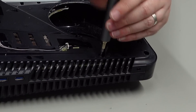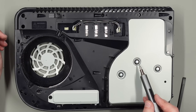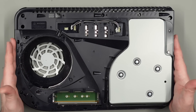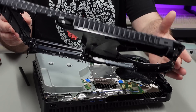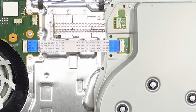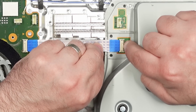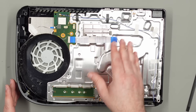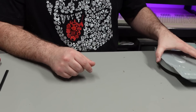So let's start with this screw — find it and remove it. The only ones you want to leave in place right now are these four screws on the optical drive. Once you've removed all the screws including the SSD cover, this black piece should just lift off. I've deliberately left all the screws in their holes because a lot of them are different lengths and I don't want them mixed up. We've almost got the optical drive out — just disconnect it by pushing this little silver tab back and pulling the ribbon cable out, and it should lift right out.